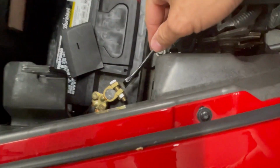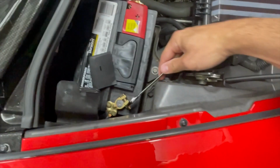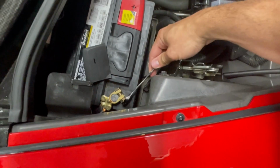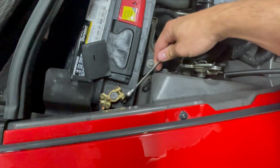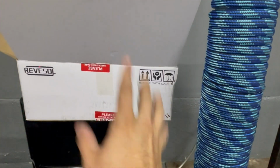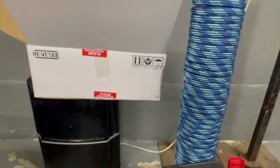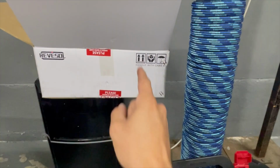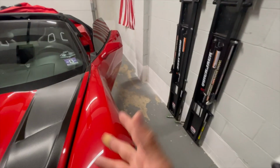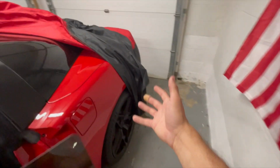First step is to remove the battery, right? Because we're gonna deal with airbags though. Steering wheel, there's a link in the description below for the website. They sell from eBay though, so you gotta go to eBay to buy it. Yeah, it's very important to disconnect the battery because we are dealing with the airbags.